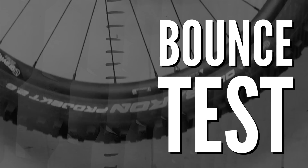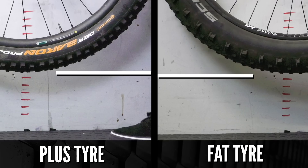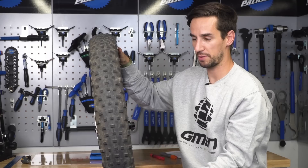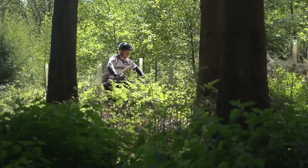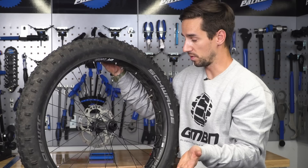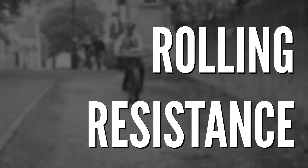I've done a bounce test — it's not very scientific, but I dropped a wheel to see how high it would bounce, starting from the same point. That does show that the fat bike tire bounces marginally less, which is the opposite of what Blake said, where it feels like it's a more bouncy wheel. I think the reason it bounces less in my test is the more volume of the tire — in that impact, that can be absorbed by that bigger tire with much wider, much deeper sidewalls. But there's no arguing the fact that when you ride these bikes, they do feel like you're sitting on a tractor seat and they do bounce around quite a lot. It's down to the size of that sidewall — probably three or four inches deep as well as wide — and it's not damped at all. As soon as you hit a bump, you start bouncing and keep bouncing for quite a while with a fat bike tire.